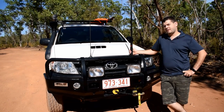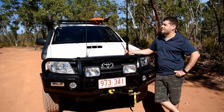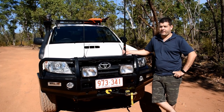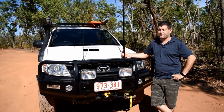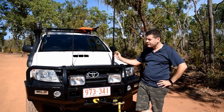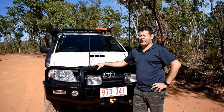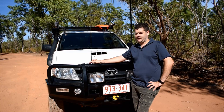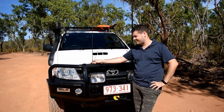We've got a 6 dB UHF aerial over here — it's a good 1.2 metres. The reason we've got such a big antenna is purely for the terrain that we live in. The sort of touring we do at the moment is very flat terrain, so this gives us the range that we need. The second antenna over here is our FM antenna, replacing the factory one with something bigger that gives us more radio reception as we head further from civilisation.